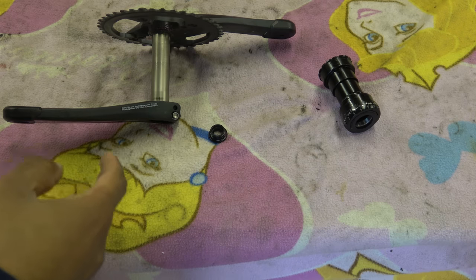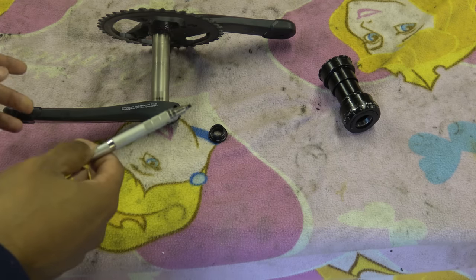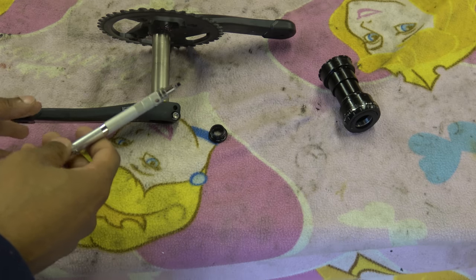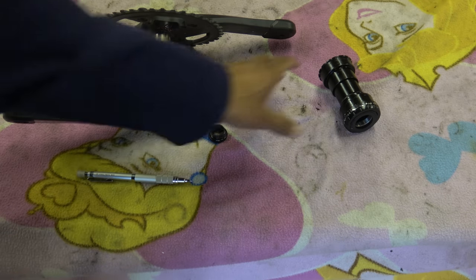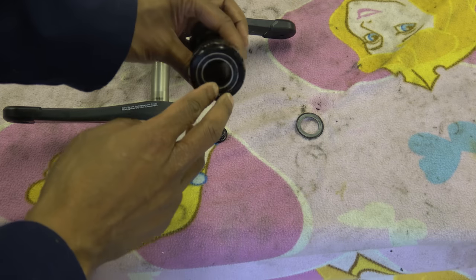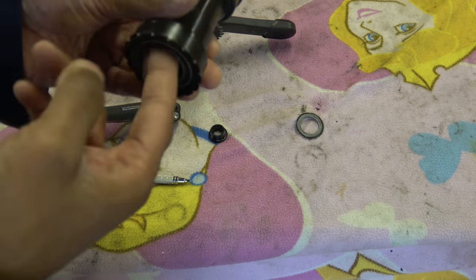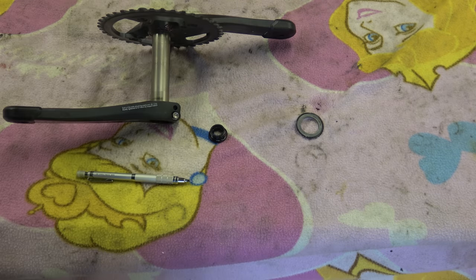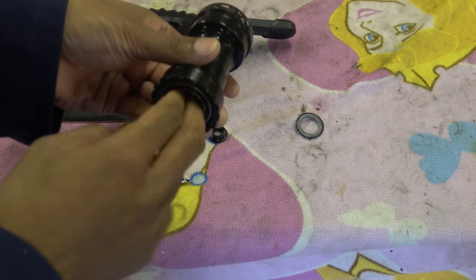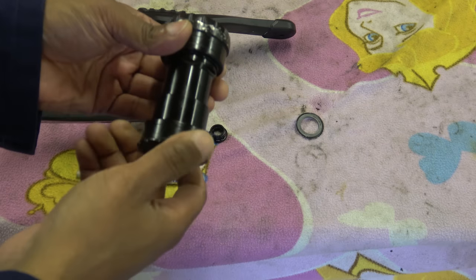90% of the diagnosis is the history. The guy said he bought the bike pretty much brand new, did one ride on it — 40 miles — and then he had problems with the bottom bracket; it was essentially not spinning. Now just by hand, that side's okay. That one isn't. It's almost like gravel. To feel, it is horrible.